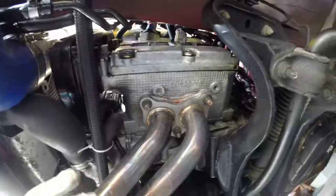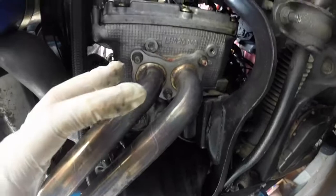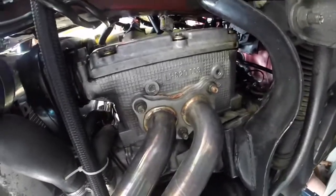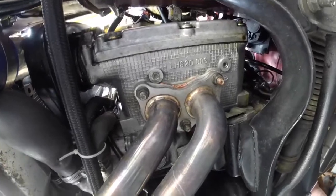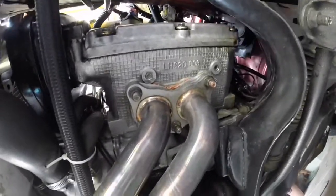So what I'm gonna do, I'm just gonna take the exhaust manifold off. The exhaust manifold has to come off when I take the engine out anyway. I'm just gonna look to see if I can physically see anything - the exhaust valves in the head. Because that's what it sounds like. It sounds like an exhaust valve. I'm just gonna have a little peek.